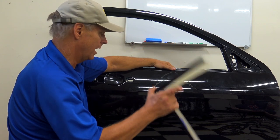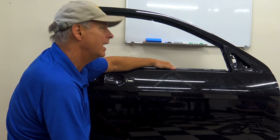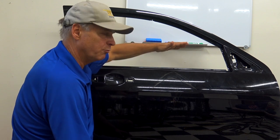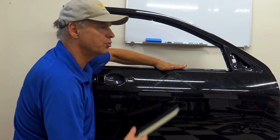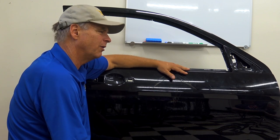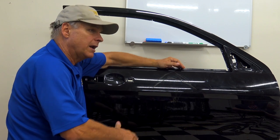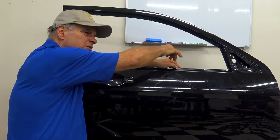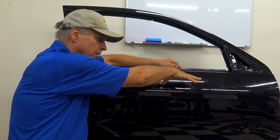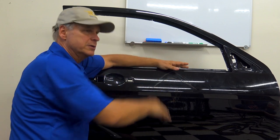Now, when would I recrown? That is a matter of experience. There have been times when I immediately recrown. You just know from experience. Or maybe I'll wait until later. What if I don't have experience? Do the test we talked about. Get the body, try it first. If it's not doing the thing, move the body line. Get most of that out of your crown up first, then try it again. If that's making a little difference, then go ahead and do it.